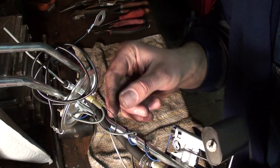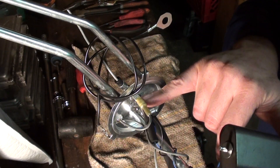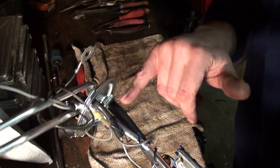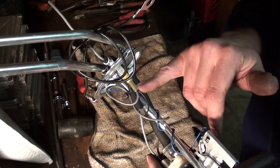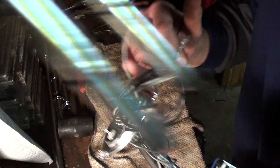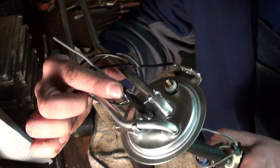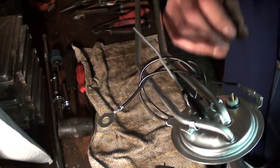The ground from the sender and the ground from the pump I ganged together and I made a bulkhead just using simple 3/16th fuel line, and I epoxied it where it meets the tank lid, epoxied out of here, crimped it down to limit movement and possible chafage.